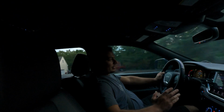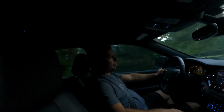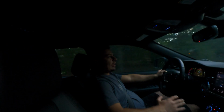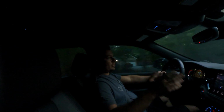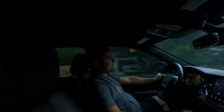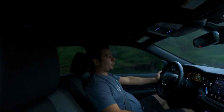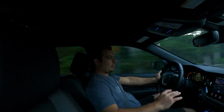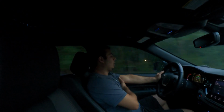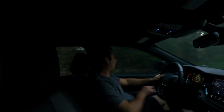It's not like the Lexus, and it's not like the Mustang, where they don't have a whole lot of grunt down low, but a ton of power up top. This is the opposite. Most of its power is down low, and it peters off up top because it's a pushrod V8 and it can't breathe as well. That's where the difference is with these. As far as power delivery is concerned, we're comparing apples to oranges. It's a different style engine, and it's in a different type of vehicle, but it still does have V8 power, and it moves pretty good.